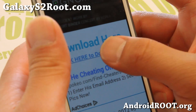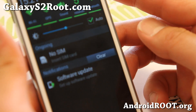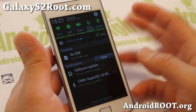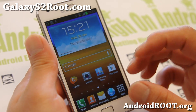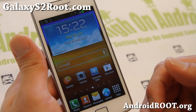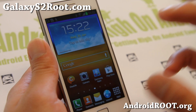Wait 5 seconds, then click to download. It's not a big file — it won't take long. Download complete. You just need to get it on your phone somehow. That file gives you root — the SU binaries and the SuperUser APK, basically two files it's going to install for you. To install it you'll need ClockworkMod Recovery on the Galaxy S2.